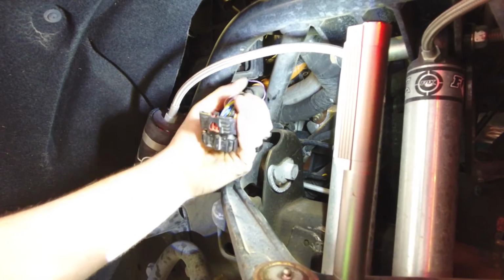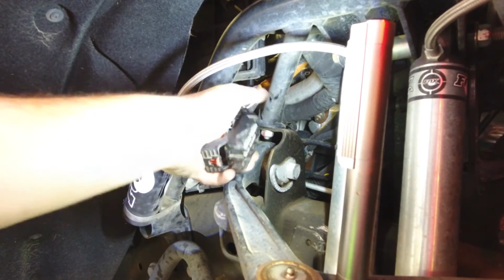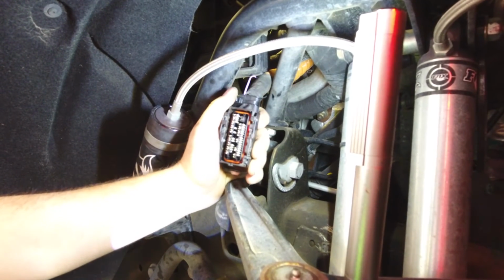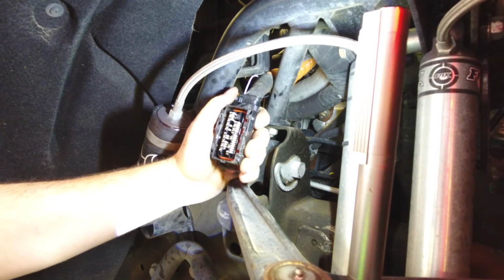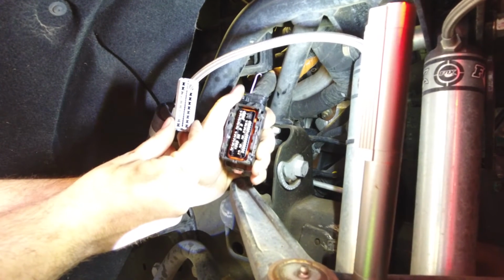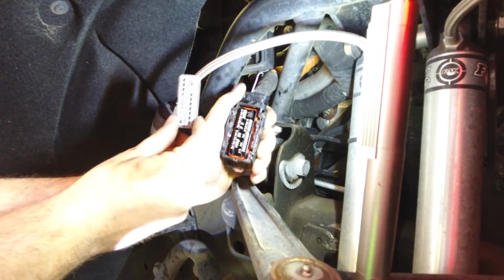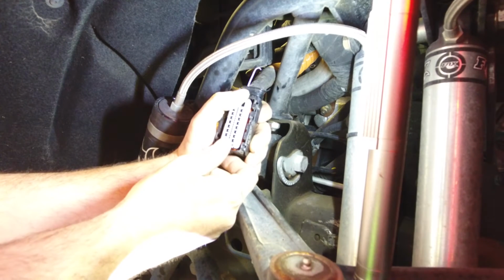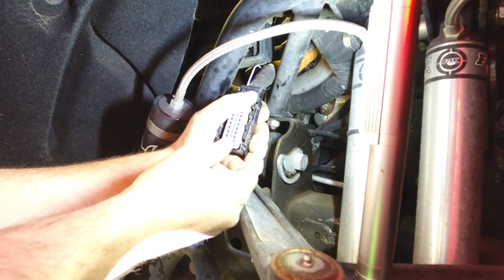Make sure all the wires are squeezed back together fully, and then we'll go ahead and put the bottom retainer clip on, the white retainer clip. Only goes on one direction, easy to see. Be very careful sliding this back on that you don't bend any of the pins. Just gently apply pressure until it's clicked all the way into place.